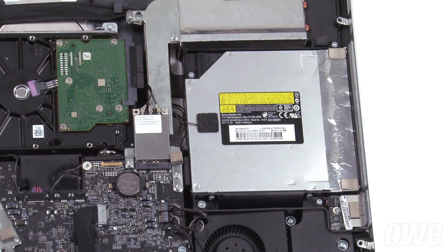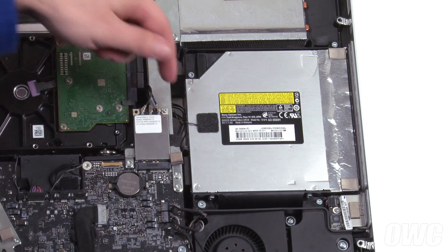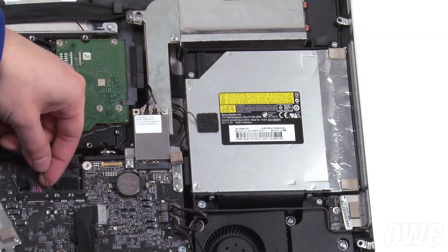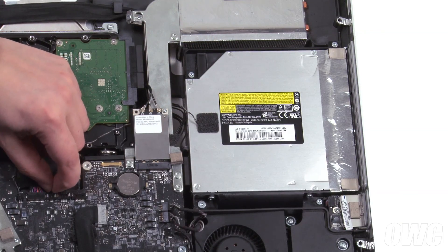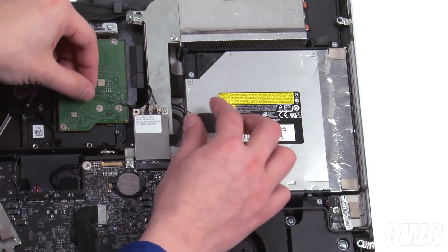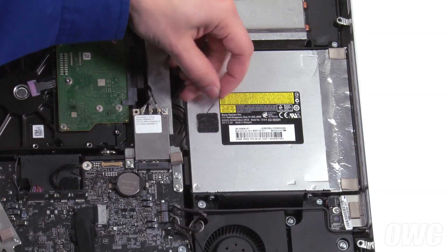Keeping your hands on the outside edge of the display, you can now lift it up and out of the iMac and place it in a dust, static, and oil-free place. The optical drive is located along the right side of the iMac. First, follow the temperature sensor cable from the drive to its socket on the logic board, where you can unplug it by sliding it out using the tabs along the top. Feed the cable out from behind the heat sink plate until it hangs free.